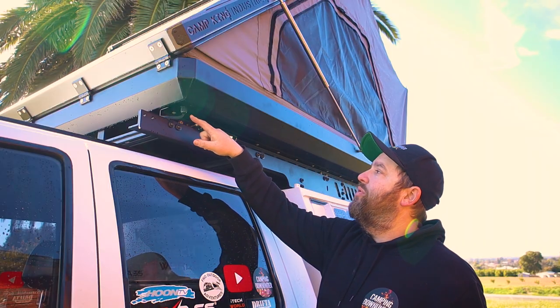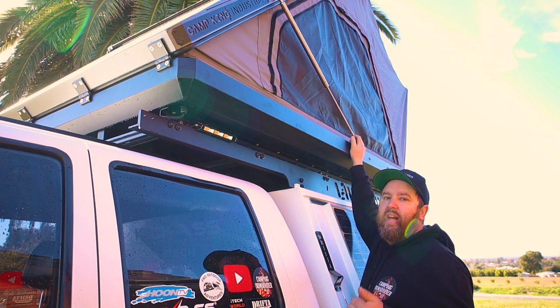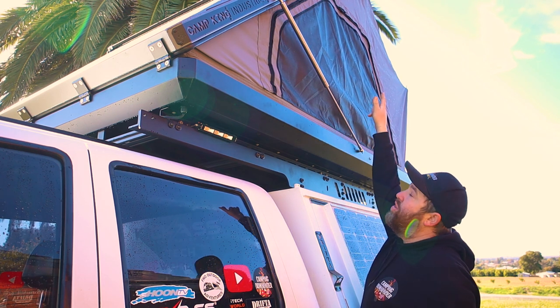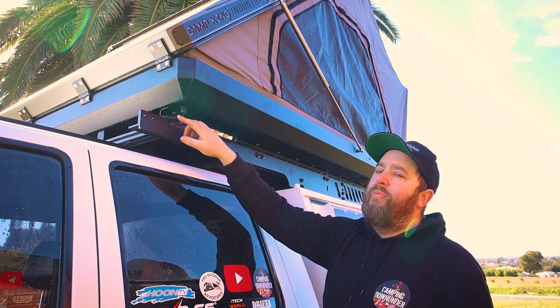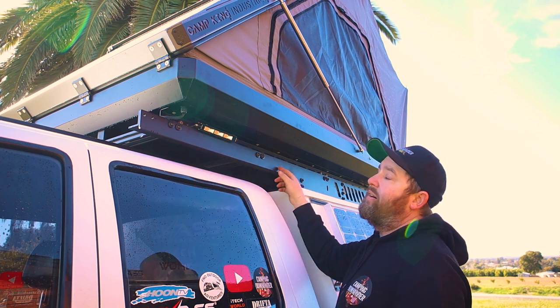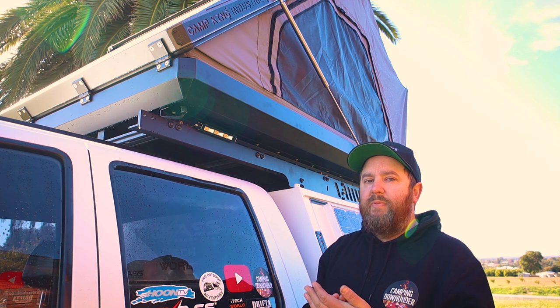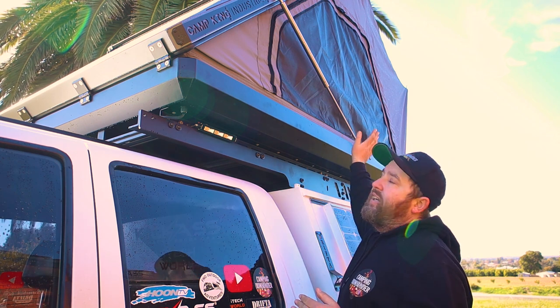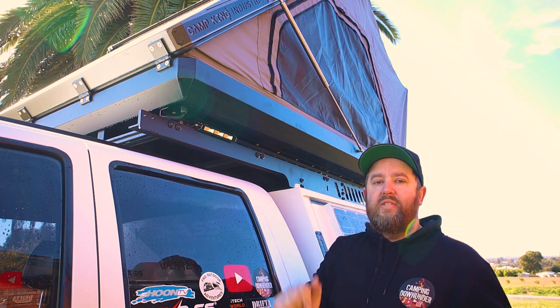Last thing left to do is connect your 12 volt. Inside right here there's a cigarette socket and two USB ports, and up the top there's a built-in light as well — they all run off the same wire just here, and that's about two metres length they give you, so you run that along your roof rack. You might need to extend the wiring a little bit. I'll run it to my fuse box with a 20 amp fuse. Because they're accessory sockets they're only rated to 20 amps, so don't go any bigger than a 20 amp fuse.